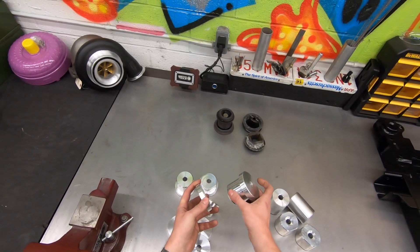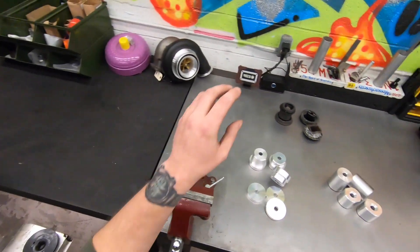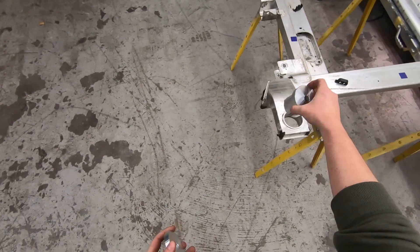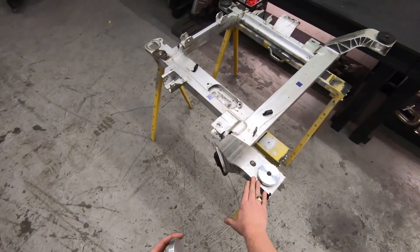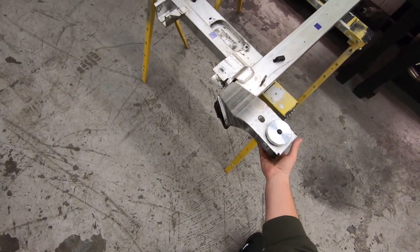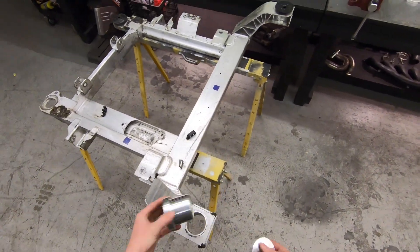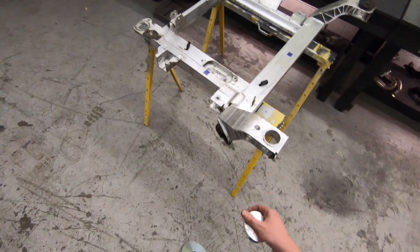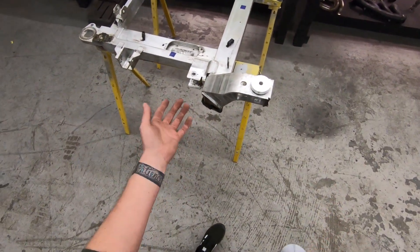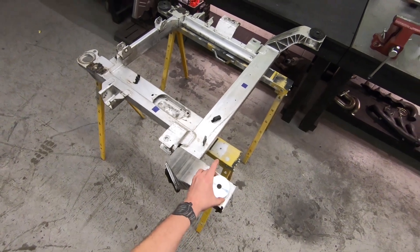For the average enthusiast, these are super easy to install. Once you have your subframe out of the car and press the old rubber bushings out, these are drop-in. You take your aluminum bushing, drop it in from the top — it's designed to duplicate the OEM height that we have here with the rubber cap. From the bottom, your washer comes up under the sleeve and you reuse the OEM bolts to attach the subframe directly to the body. What you might find is you'll want to warm the sleeve up, because this is a very light press fit.